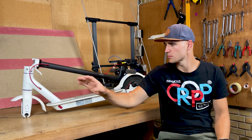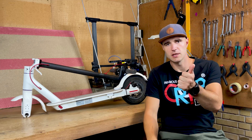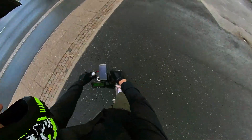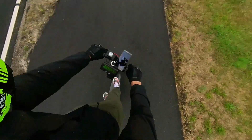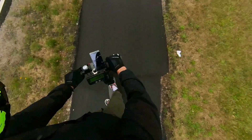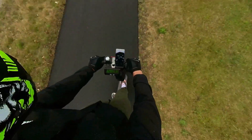The initial idea was to install this motor in front of my white M365 and leave everything else stock — replace the battery, replace the controller. It didn't take me too long to figure out that it's not going to work, because I don't want to ride at 60 kilometers per hour with all the motor, battery, suspension, and weight on the front of the scooter. I need to distribute the weight more equally. When I put this huge battery pack on the handlebars, you can see how shaky it is — it's counterbalancing the weight of the front wheel and pushing it sideways so easily, which could lead to a wiggly-wobbly situation.